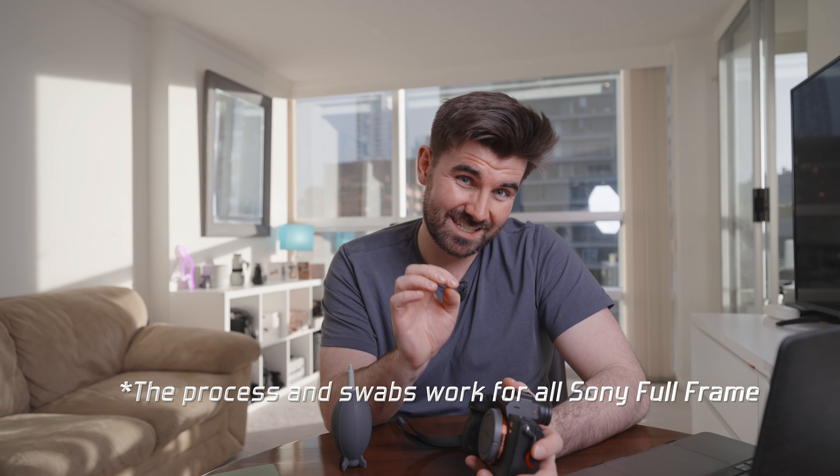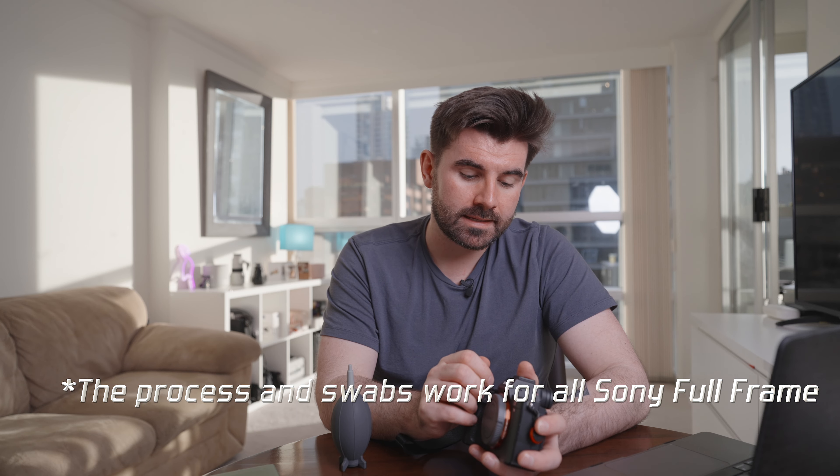I'm currently using my Sony a7 IV to shoot this video, so we're going to try and clean the sensor of my old Sony a7 III. The first thing we need to do is engage the Sony automatic sensor clean. We want to unscrew the cap and use the blower with the camera facing down, blowing up into the sensor. Then, keeping the camera facing down, navigate to the menu settings and go to the cleaning mode. The camera will shake and try to dislodge any dirt. For some people this is the last step — most of the dust will have come off and your images will look great again.